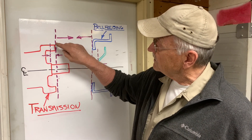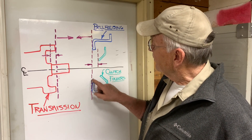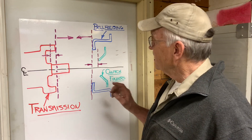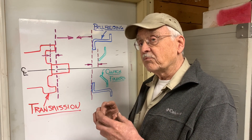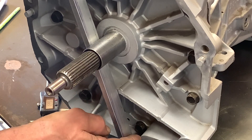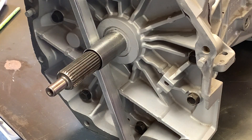What we need to do is measure between this purple line — which is the mounting flange of the transmission — and this shoulder. We need to do the same thing on the bell housing and clutch: from the outer face that the transmission bolts to, measure to the fingers. We do all of them because they'll each be a little different. Once we've got both measurements we add them together, then adjust our throw-out bearing so it is 0.125 — one eighth of an inch — thinner than that space. We'll lay a straight edge across the mounting flange and use the probe end of our dial caliper, zeroed out.